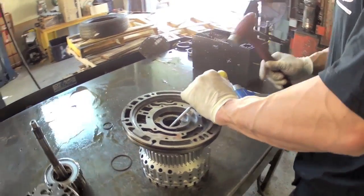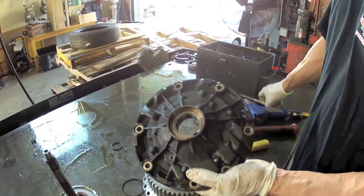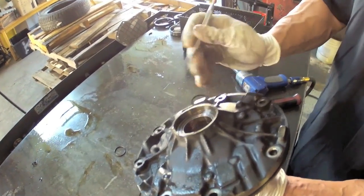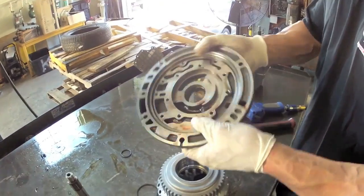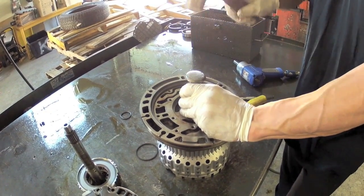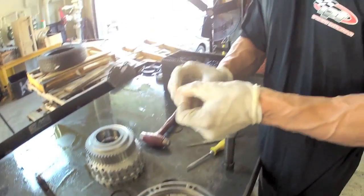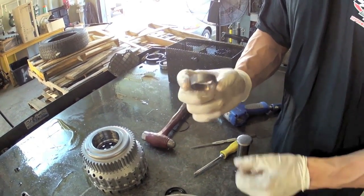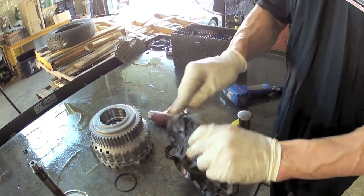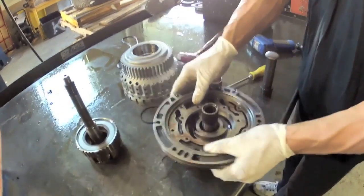The front seal — and that's going to enable us to take a look at the pump bushing. Pump bushings we almost always change, but you're also going to look for scoring and anything out of the ordinary. You're going to need a bushing driver to remove it. This will give you a little bit better look at what you're dealing with in there. You can see this one got a little blue from heat. O-ring on the outside diameter — take that off. And we put this all aside to clean it up and reassemble it.